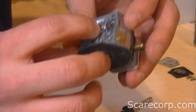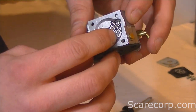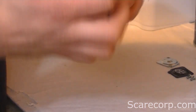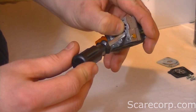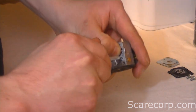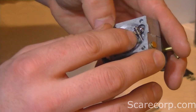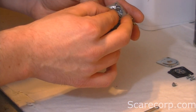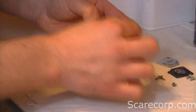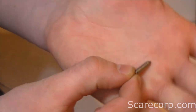In here is where you'll find your needle for your jet. It's on a spring and it usually has one Phillips screw that you can take out. When you take this off, put your thumb over pretty much the whole part except for the screw you're taking out, because this has a tendency of popping out. Try to remember how this went. Usually it has a spring and a little needle — there's that needle.